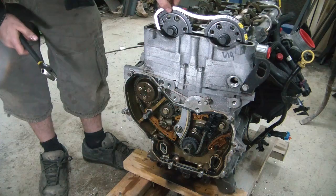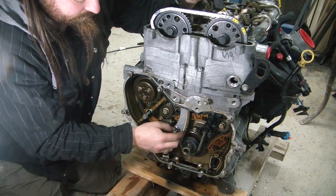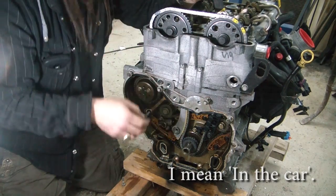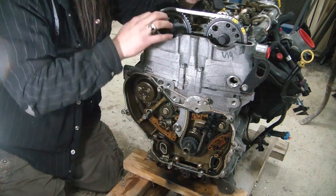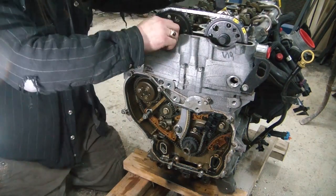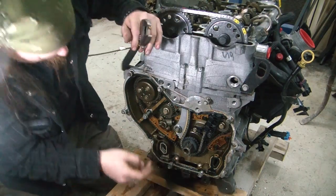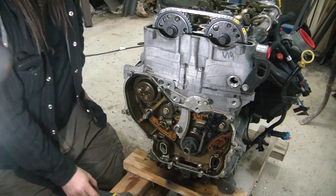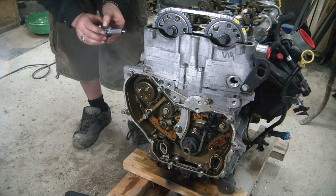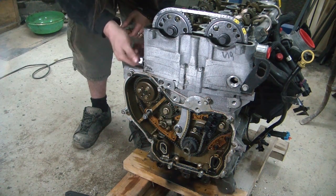I couldn't get this up in here without taking the chain off, and that of course moved it a little bit. I've heard on the message boards that this is quite the pain in the butt, and I can see how that would be out of the car. We're seated where we're supposed to be on these — both my marks are aligned. I have a line down here on this mark, and now I need to put the chain tensioner in. The instructions say it is already set and I do not need to do anything else other than screw it in here and set it to the right torque.